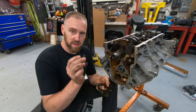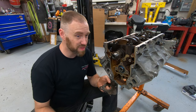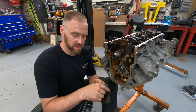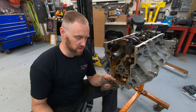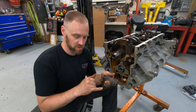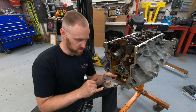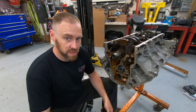When torquing the cam plate down, some have a regular bolt, this one has a tapered Torx screw. The tapered screw ones have very low torque — I think it's around 12 foot-pounds, which feels like you're not tightening enough. Do not over-torque it — it will break the plate, which is cast metal and not very strong. The bottom bolt position is slightly oblong, and even a little past spec will fracture it. From there, it's your normal job: throw your timing chain on after lining up your marks, get your valve train in, and you'll be good to go.